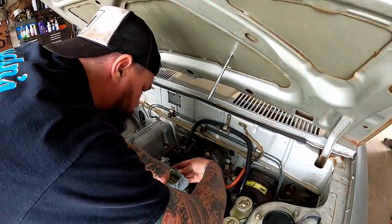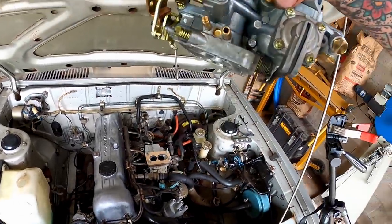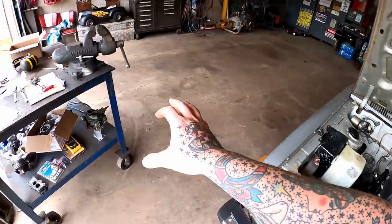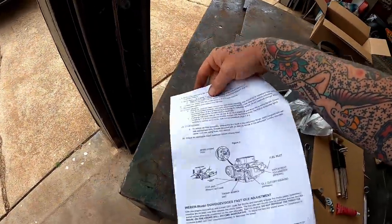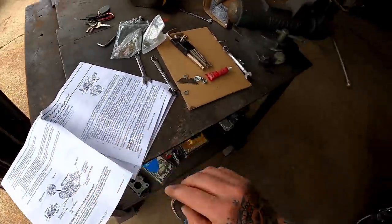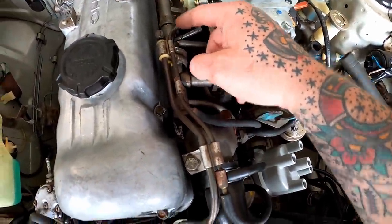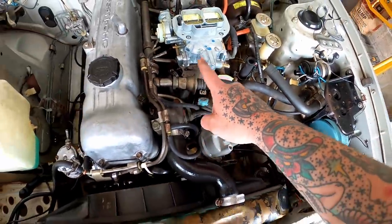I guess there's a little more room to play with throttle. Yeah, we got a port right there. So before I set that down on there for good, I wanted to come look and see what that is. Where are we at here? Right chair, vacuum advance port. So that means we need to take that baby to right here. This other one, I got to looking at it and it just goes down to this. So I don't think we need to worry about hooking it up.